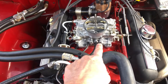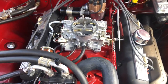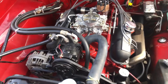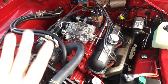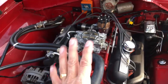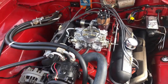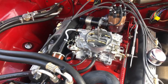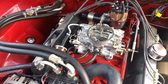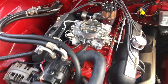The only thing I don't like about this car is after it sits, for some reason it loads up and you get a pretty good puff of white smoke. But the engine is freshly rebuilt — compression's perfect. So other than that, I would run this carburetor. It is a vintage carburetor and it will load up, but it is absolutely perfectly restored and it runs great. Other than that little puff of smoke when you first start it up — and it's gas, not oil — that carburetor runs down the road beautifully. The car gets great gas mileage.